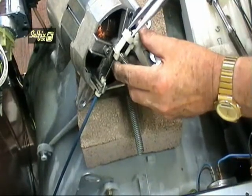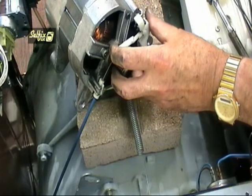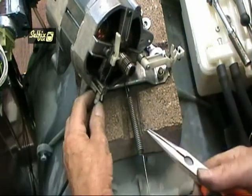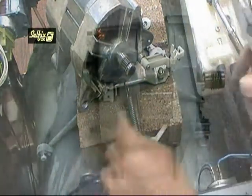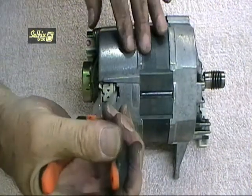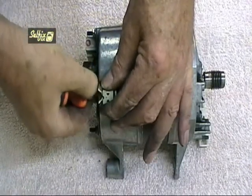It's far easier to leave the pecker and the cable attached to the motor until it's off, because you can't really see what you're doing down the rear of the machine. If you're not replacing the motor, they don't need to be removed anyway and can stay put. Removing the brushes while the motor is out is much easier and allows for a closer examination of the commutators and their condition.